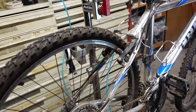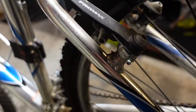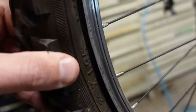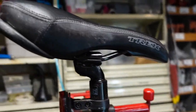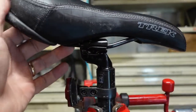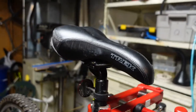I think we'll start by taking a little walk around and looking at a few things. You can see how dirty things are back here — this one's been ridden in the dirt a little bit. I'm not too worried about this little bit of rust on the freewheel. The tires are super flat. You can see the saddle is kind of all the way back, which makes me think the bolt might be a little loose. I'll loosen that up, slide the saddle forward, and tighten it back down. Overall the saddle looks to be in okay condition — it's a little bent in the front, but I think it's a keeper.